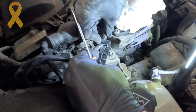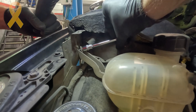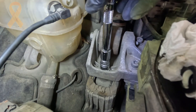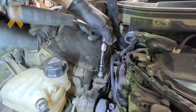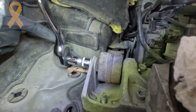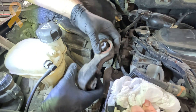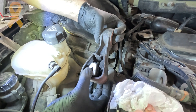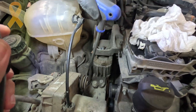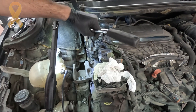For more convenient access I removed the feed hose of the fuel filter — this will be necessary later anyway when I replace the filter. I removed the bolt holding the expansion tank using a 10mm socket and disconnected the two hoses attached to it. I removed a few more bolts with 15mm heads and a Torx bolt that hold the engine mount in place. First the top mount comes off — this will need a replacement. After removing a couple more Torx bolts I could remove the second bracket that supported the engine as well.